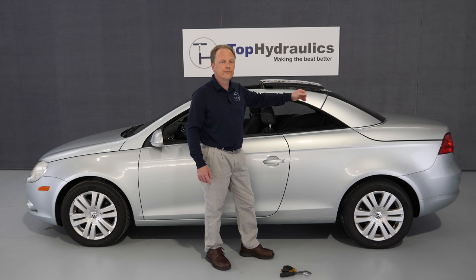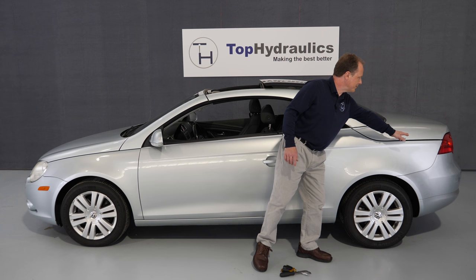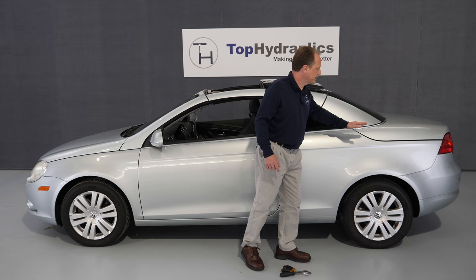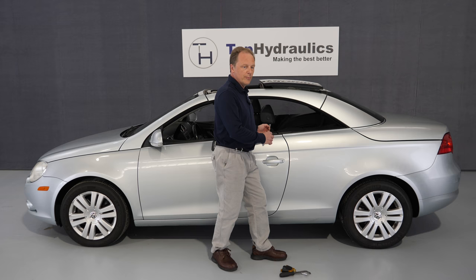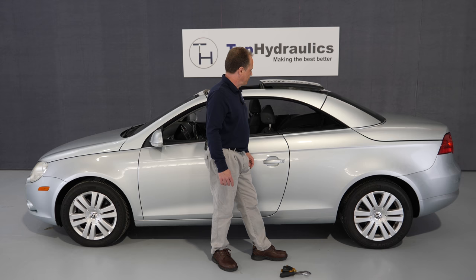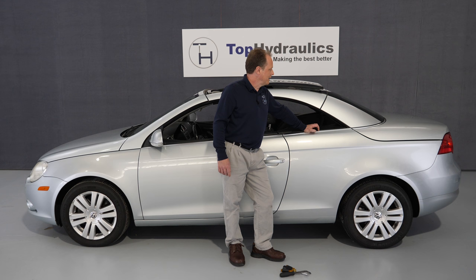Next we'll go to the trunk. We'll show you how to undo a couple of Torx screws for tension cables, undo the pressure relief valve on the pump, and remove some trim panels inside the trunk frame so that we can unlock the trunk frame. Then we'll show you how to unlock the roof member lock inside the rear glass panel. After those things have been unlocked, we can manually lift the top and let it drop into the trunk. Two people can do it fairly easily, as long as you are detail-oriented and able to follow every single step.